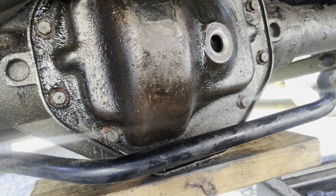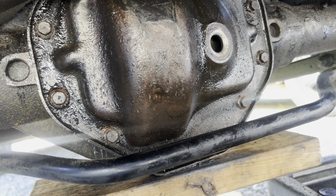We're gonna fill it till the fluid starts coming back out that hole there and then we're gonna plug it with the rubber plug. This is a 392 anti-spin rear differential so I'm gonna be putting 75-140 in it.